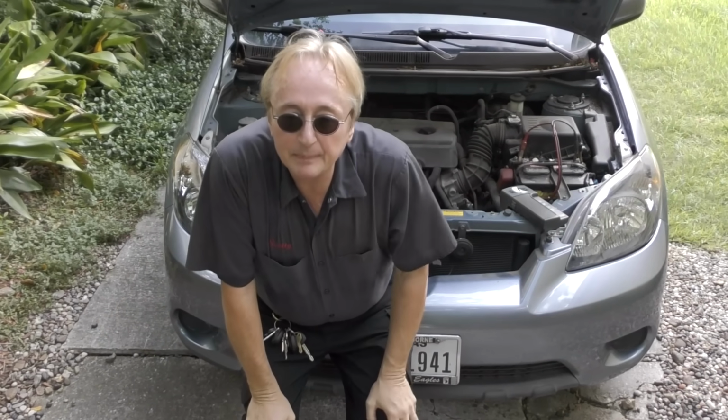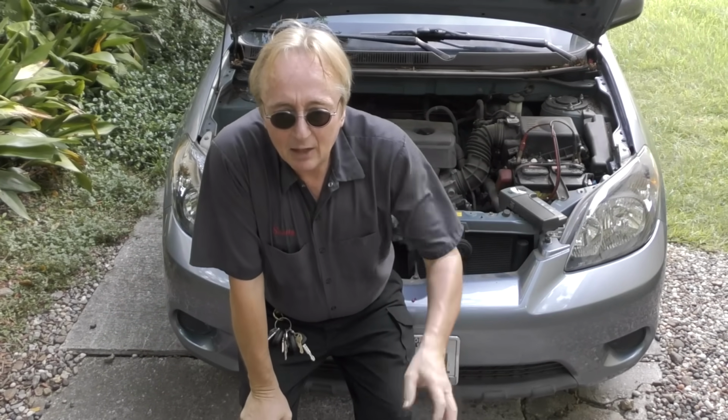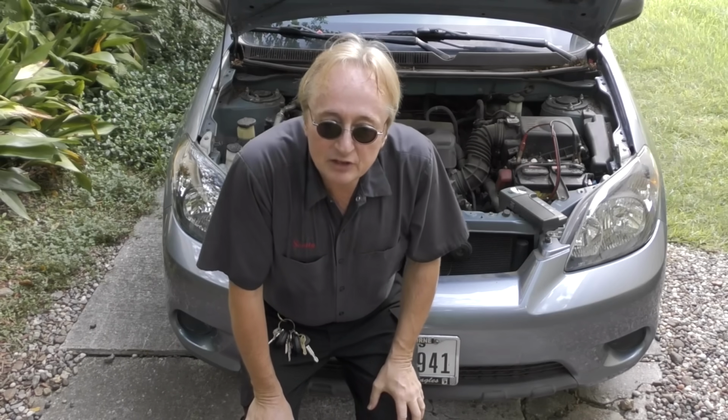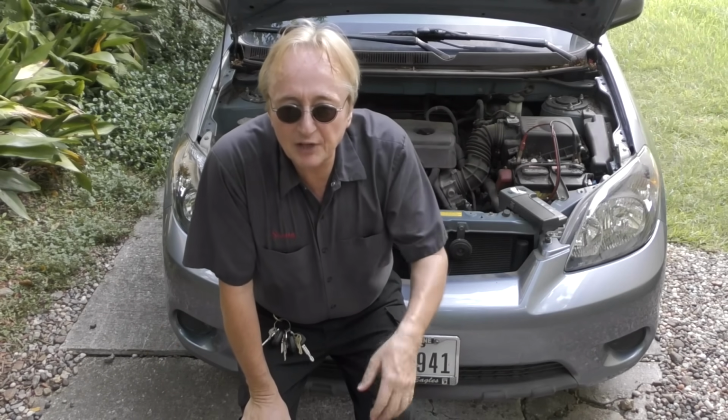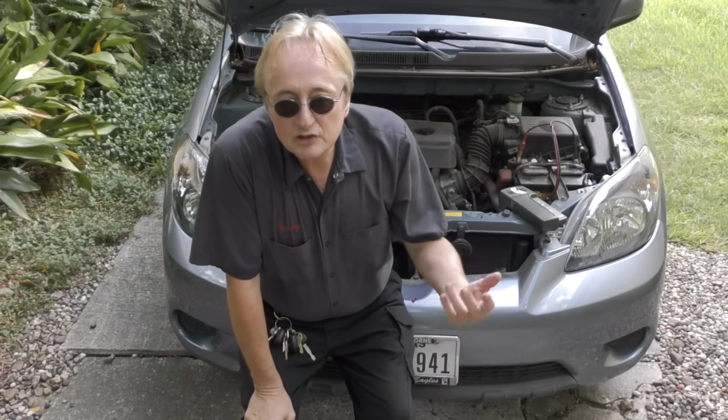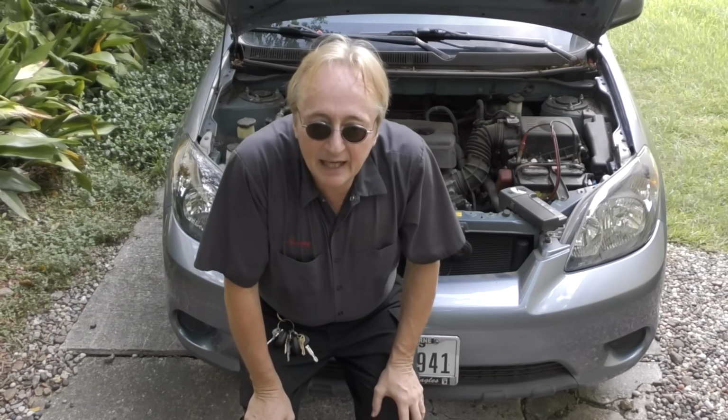In the past, I've had people come over here and they said, "Oh, Scotty, when I was doing my windows, it got dull, so a guy sold me a window motor assembly for the driver's side, but it still does it." And then I find out that the alternator was weak, wasn't charging, and he'd wasted all his money on that window assembly. Now, if your battery checks out okay, and your alternator checks out okay, and it still does the dimming or idling poorly when you turn it on, then odds are the motor is just starting to wear out, or the regulator.